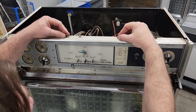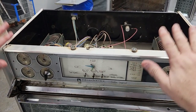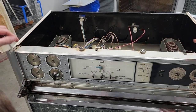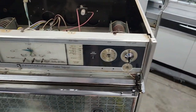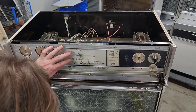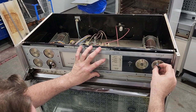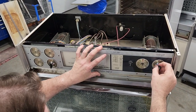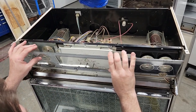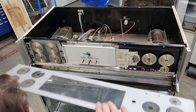These two pieces here secure the top plate when it goes on — they hook up underneath here and go in the two middle positions, with regular Phillips screws on the sides. The top trim will come off holding the glass. See how flimsy this is? If your knobs weren't there, it can tip out. Go ahead and remove your remaining knobs, and the glass will just come out, clearing your time knob, and come out just like this.